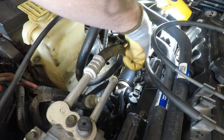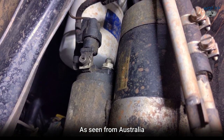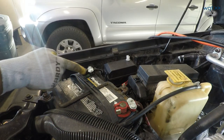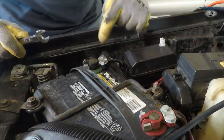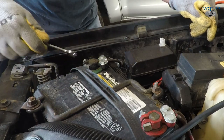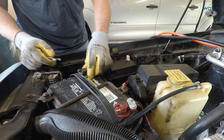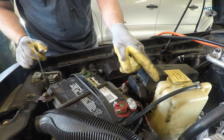The little guy we're going for is right down in here, but you'll notice we're working perilously close to an exposed terminal on the starter. Even though a lot of people do successfully work this job, I'm going to disconnect the negative battery post just to make sure I don't have any unhappy accidents down there. Mine disconnects with either a 13mm or a half inch socket — yours may be different. Tuck that out of the way, and hopefully now we're not going to have any issues.